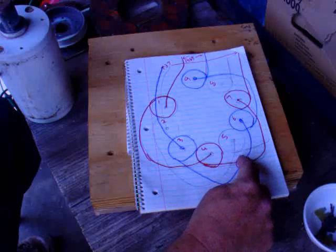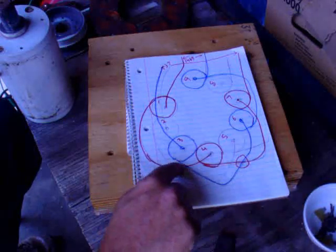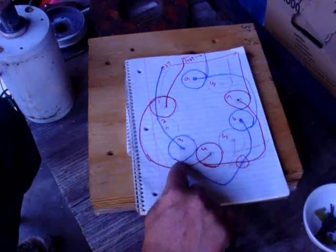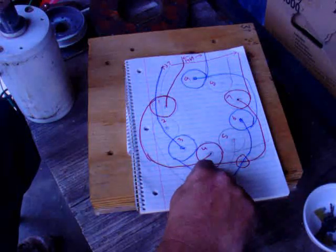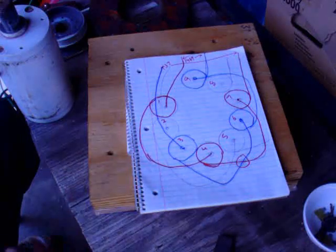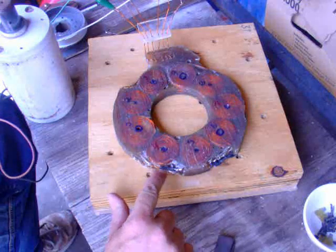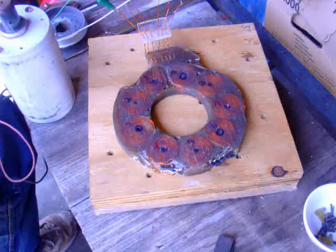I was looking for it over here. What I didn't realize — this outside, the coil, the wire comes to the inside of the coil as a start, then goes out to the finish. This wire comes out here and runs over. These wires are connected. This is the same as this wire getting really close to the side of this coil. When I fixed the connection here, it heated up the solder joint over here next to this coil and melted it into the coil. So the problem was not pre-existing — it's something that I did while I was repairing the stator. Now everything is 1.8 ohms all the way across, and now we got it fixed and she's all ready.